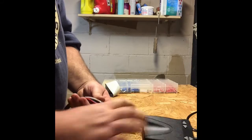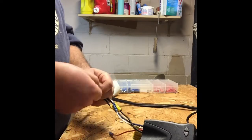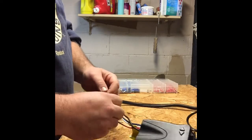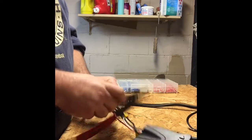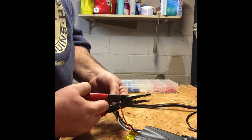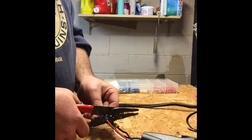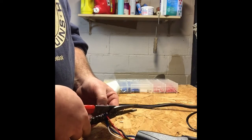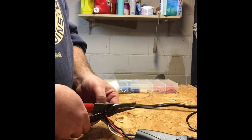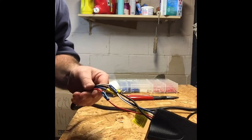And lastly, our red wire. Make sure his wires are twisted before you set this inside your connector. Okay. Slide our tool back over. Make sure we're in. And once again, squeeze and go all the way down the line. Okay. Now, these connections are complete. Because this is interior, really, I could let those connections sit like that.